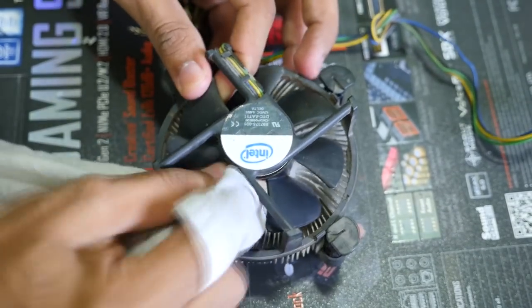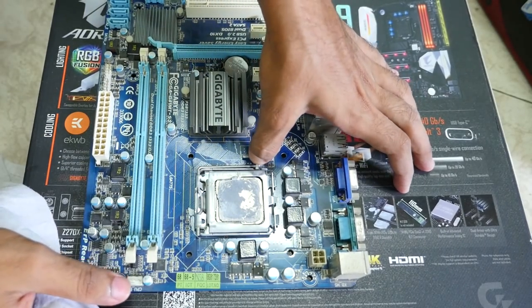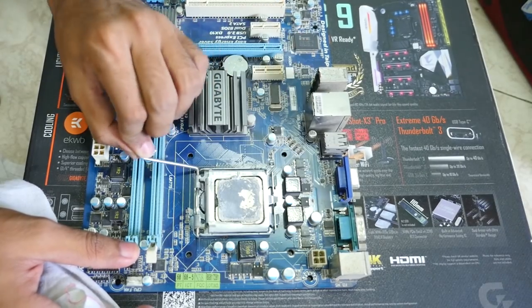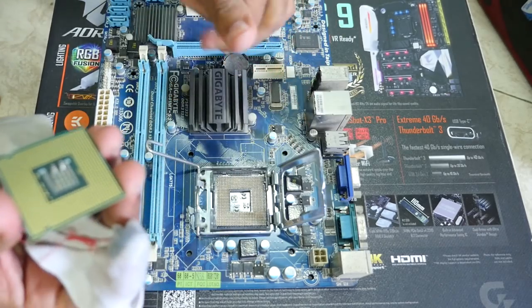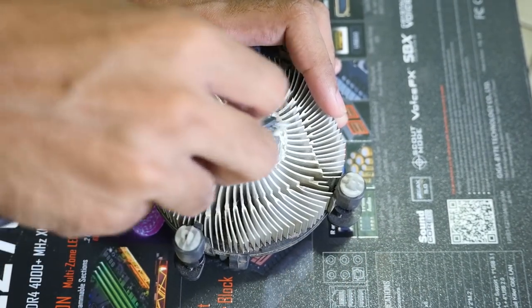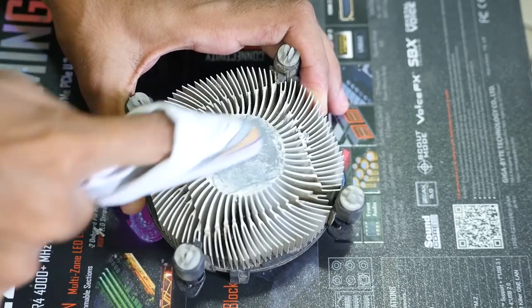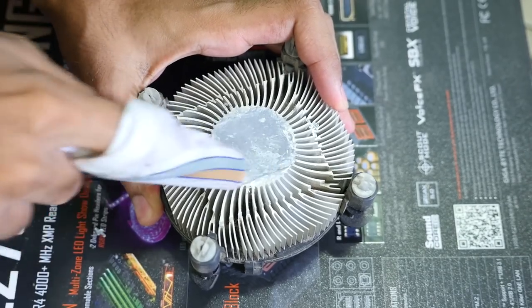Finally it looks good and I'm pretty sure it should start working now. We need to remove the thermal paste on the CPU cooler and on the processor. You can remove the processor using the clip — I'd suggest taking a picture of the processor too, just in case you forget how to align it again. Now we need to clear the solid thermal paste from the CPU cooler as well as the CPU — it was so solid it was really difficult to remove, even with a plastic scraper. To clean it, use a clean cloth and 99% isopropyl alcohol. You can buy it from Amazon or get it at medical shops. Do not use drinking alcohol as it is not pure. Make sure the surface is even because we're going to put new thermal paste on it.